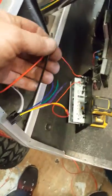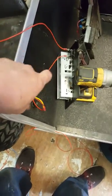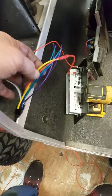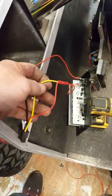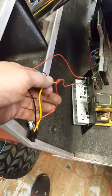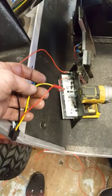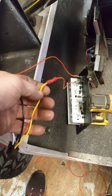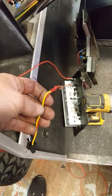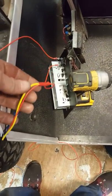Where 12 volts is — or if you have a Club Car like this, 16 volts — it won't burn up the radio. If you wanted memory, you would take the yellow wire and hook it straight to the battery as well, but if you don't use it every day or at least charge it once a week, it will kill the battery. We leave it out because a lot of our customers come down here for a couple months out of the year and then go back home.